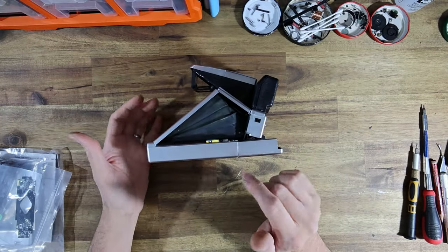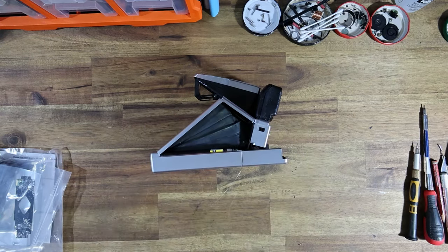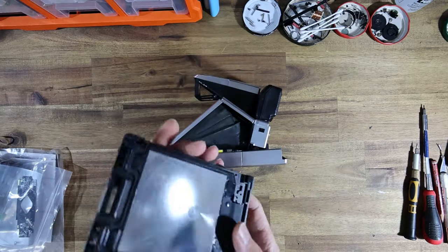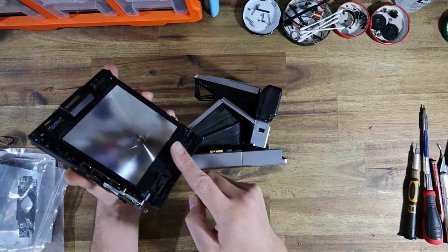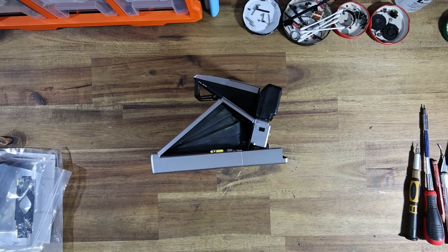And one of the other things that I'm going to do, in addition to this camera, Jeremy sent along a SX-70 Model 1, which was in super rough condition, absolutely beat up. And I managed to salvage the chassis from it. We always knew that the camera was not going to be refurbished, but I did salvage the chassis, and in particular, I will be reusing the Fresnel screen from this. Reason being is that the Model 1 had the split prism, and the Sonar and all autofocus models never came out with that. So I'll be swapping these mirrors over once we're inside the camera. So I'll walk through that in just a second. But yeah, I think we should start just by tearing this thing apart.